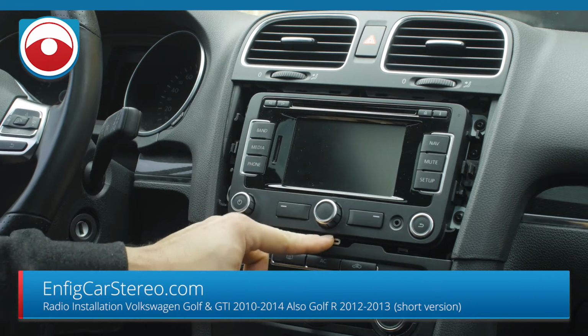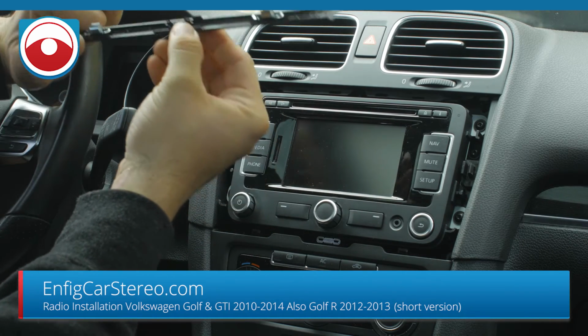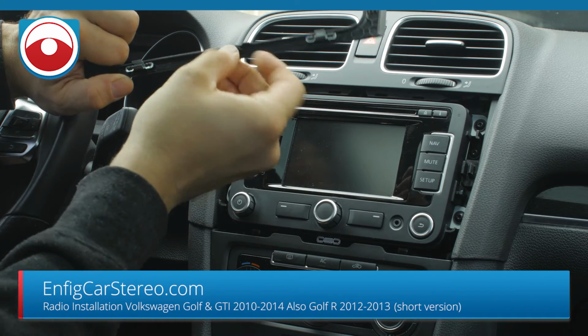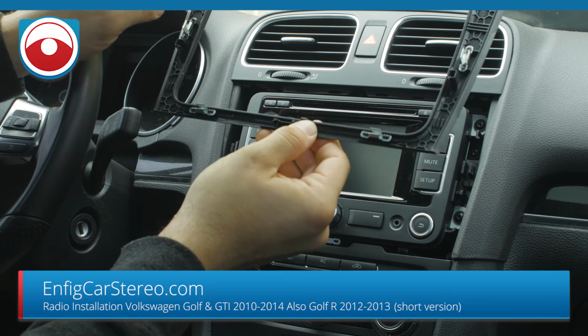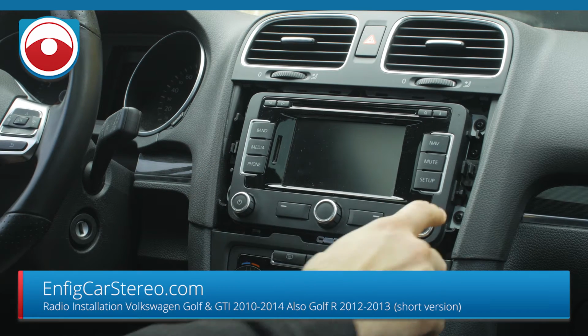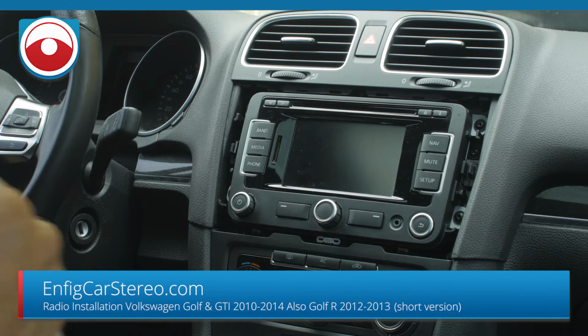That'll be easier to take off once the radio's out. So all you have to do is put them back in here, clean this up as much as you can, and put a little dab of crazy glue or hot glue on there. They're just not designed well, because metal's stronger than plastic. It's common sense. Now to take out the radio, you're going to remove 4 T20 Torx screws, counterclockwise.